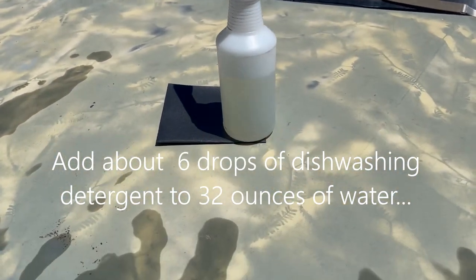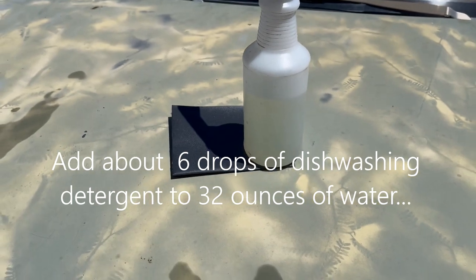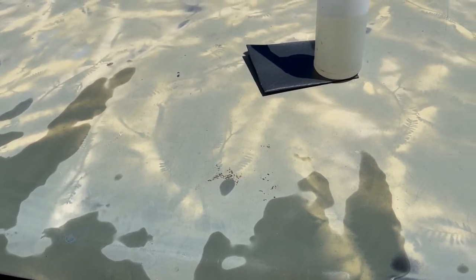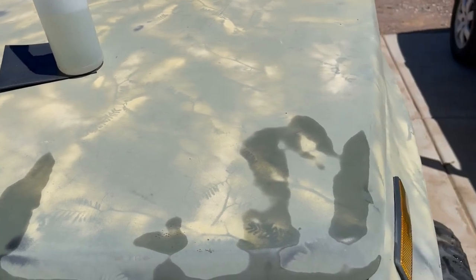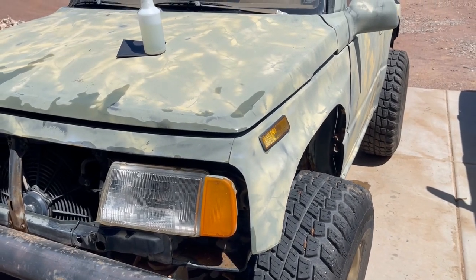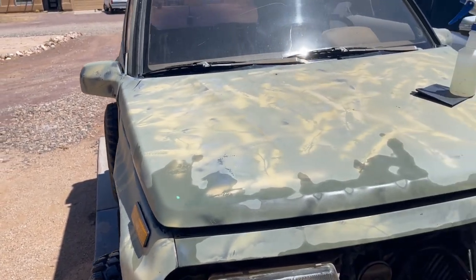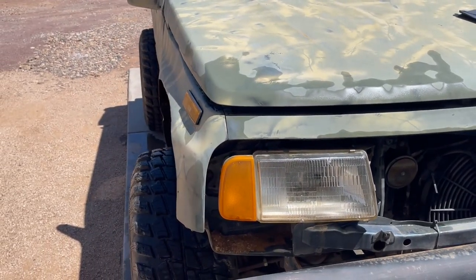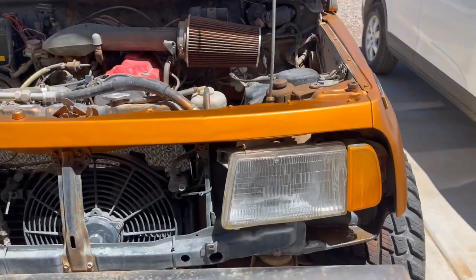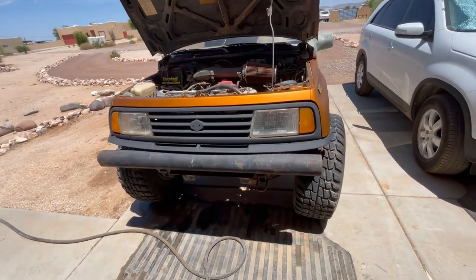When we do this we keep it wet — in this bottle it's water with soap mixed in. The reason for the soap is that part of the surface prep process, by sanding, is to clean off any grease and oil spots that would cause the paint to fish-eye on you. But again, this is an off-road vehicle — it's not going to see SEMA or a magazine cover, it's going to see the desert. Don't be uber critical; if you're doing it yourself you can still do this and have a good-looking vehicle.